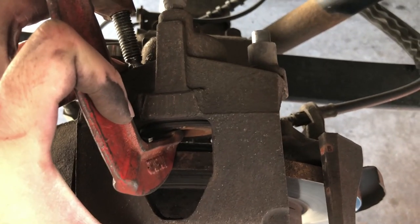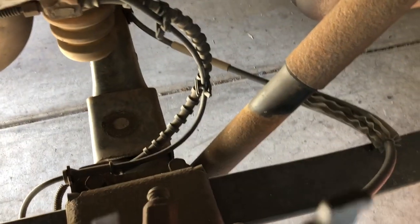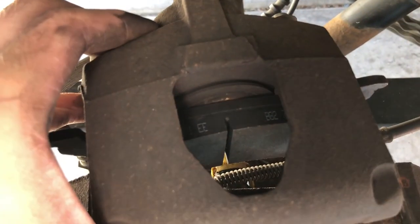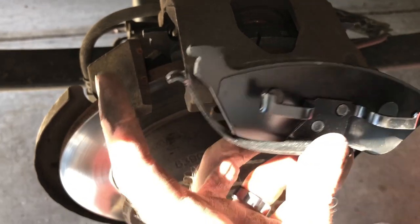When you're putting the brakes back in, make sure you put this one in first — the one that inserts into the hydraulic clamp. If you do it the other way around you're not going to be able to get this piece inside the hydraulic clamp. It has to clip inside that hole. That mistake on the other brake is what took me 17 hours. I used both hands — basically just butted it up in there and those little clips fit right inside the hydraulic clamp.